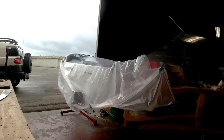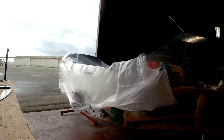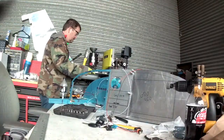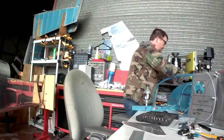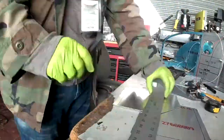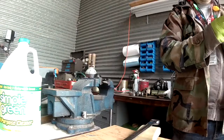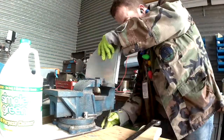What I'm working on today is coming up with a system. I've seen some other builders' panels done by other companies — I feel guilty enough just stealing this from seeing their design — but basically I'm making a shelf. Imagine a shelf behind the G3X monitor cutout in three dimensions: sides and a bottom. With that shelf you can mount a bunch of these boxes directly behind the display, so if you need to work on any part of the Garmin system, you just unhook the wiring harnesses from the back, unscrew the front of the panel, and remove the whole thing at once.